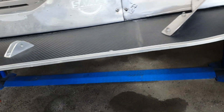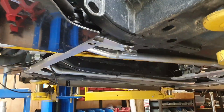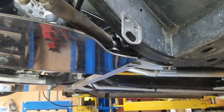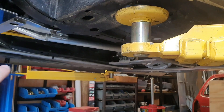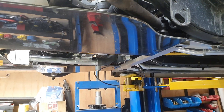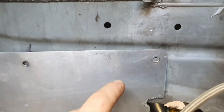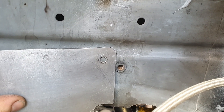I'll do something new with this bracket and put it back on because I need to make sure when I put this panel back in it's going to be in the right spot, since we've changed some things under here. This is a new piece — the old piece is on the trolley of things that won't be going back in the car. This is now level with the rest of the floor pan under the car going through to the rear diffuser, so we've got a lower frontal profile, more aerodynamic underneath. The difference that's made — you can see these screw holes no longer line up with the rivnuts behind there. That's how much higher the floor is in that area of the car.